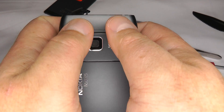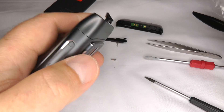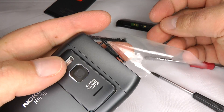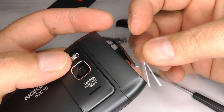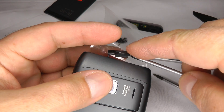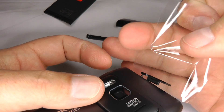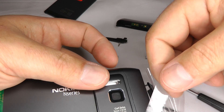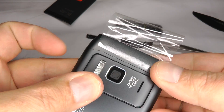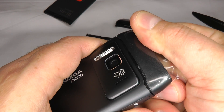A lot of people have trouble pushing the top off from the back, so here's an alternative method. Take a piece of sticky tape and apply it along the top. Make sure the HDMI port is lifted out so that little stem isn't sticking inside, then bring the tape over so it sits on top. That gives you something to get hold of, and then you can just pull the top up and it comes off.